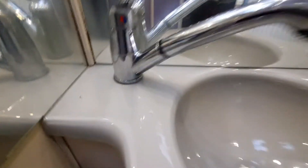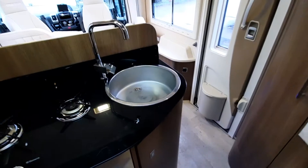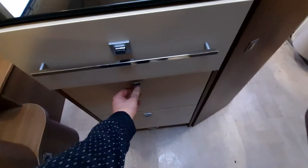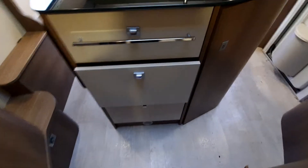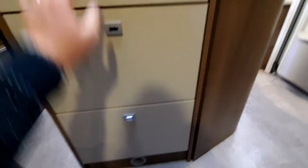Once we've filled up the fresh water and filled up the boiler in the compartment, we can come to the taps, put the pump on from the control panel, turn the tap through to the hot position, and then open the tap to fill the boiler. It is imperative that you fill the boiler first and then select your electric or gas option before trying to do anything with the heating of the hot water. Soft-close drawers are fitted throughout — they were a little ahead of their time and gently close to lock fully in position, just clicking in with buttons.